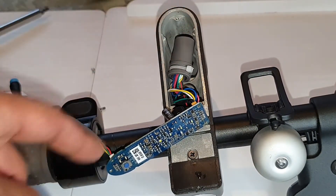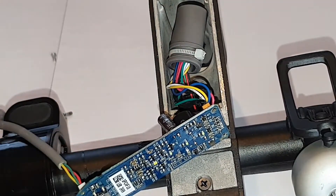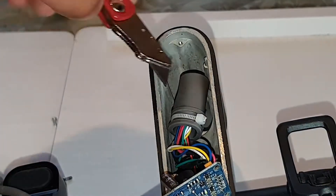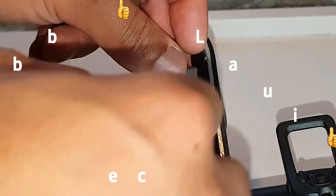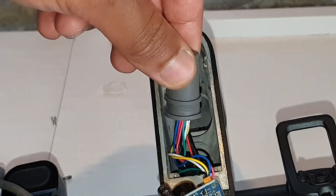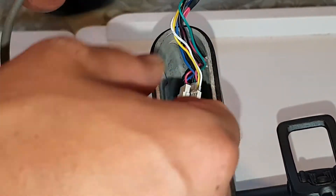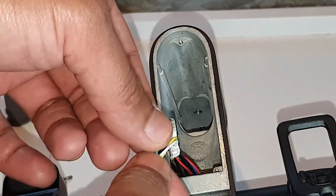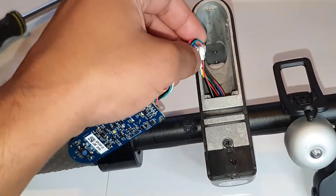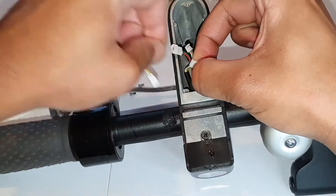The next stage is you've got this little rubber seal here. With this rubber seal there's a zip tie on it - you need to remove that so you can access the cables underneath. I've just cut my zip tie open and you just remove the zip tie itself, then this rubber should just slide off. As you can see our connections are here, so now you should be able to grab the motherboard and disconnect all three connections. Just make sure you do not rip the cables.